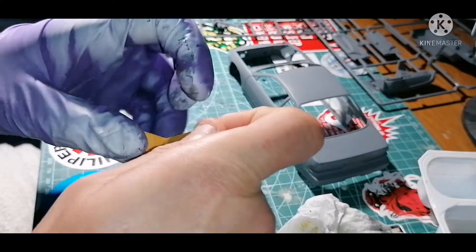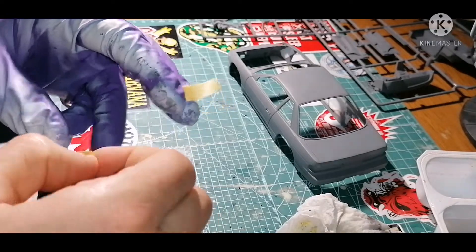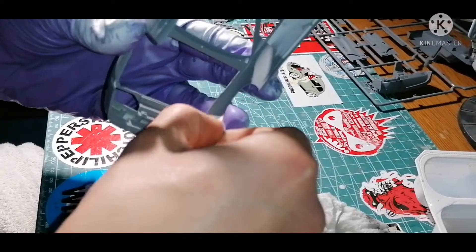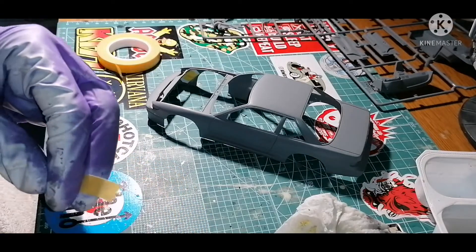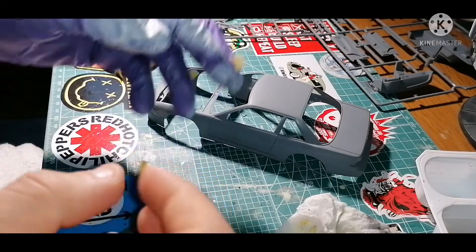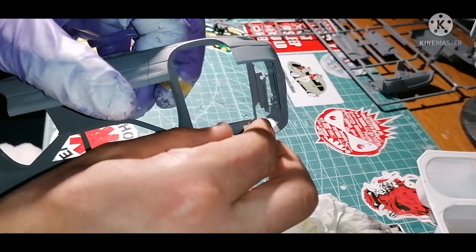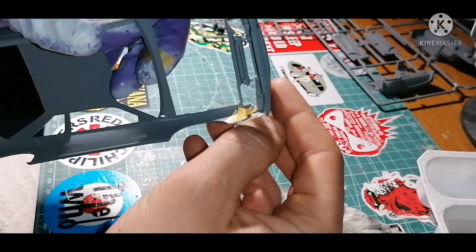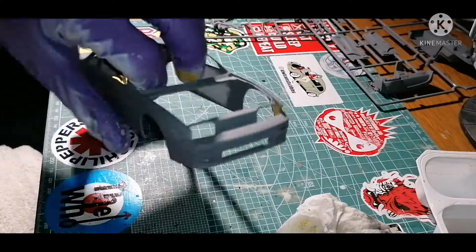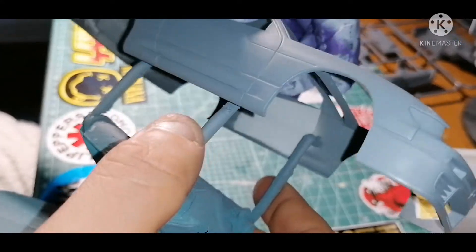Here I'm getting a bit of tape to put on the inside of the bumpers to attach them to the bodywork. I like to spray all the body parts at the same time — the bodywork and bumpers together — so it's a more even finish. You're not running the risk of tonal difference in the shades of color; you're getting the same amount of paint from one to the next, at the same temperature and humidity, all done at once.